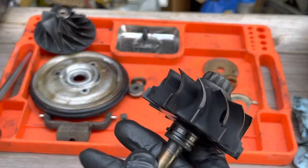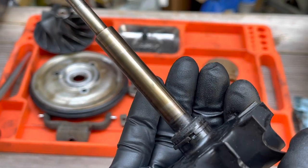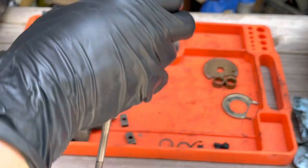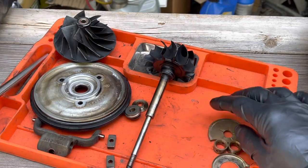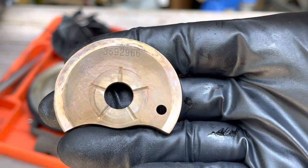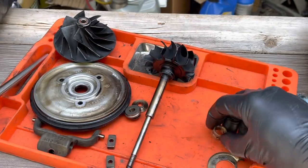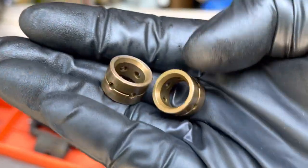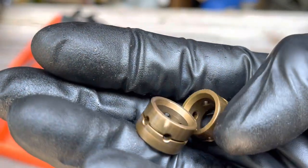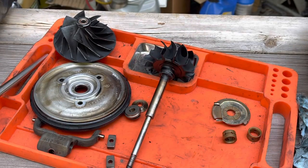The turbine shaft and exhaust impeller - light witness marks are okay, we're looking for any deep gouges and this looks good, so it will go in the ultrasonic bath. These are your consumables - the brass and all that. The thrust plate looks good for 250,000 miles, generally not an issue in these turbos because it's very thick. The journal bearings look good with slight witness marks but no real issues. The oil deflector has no problems - there's an updated one of these available.